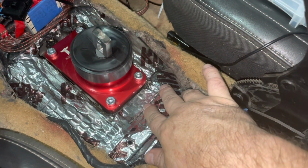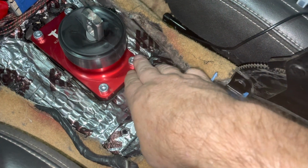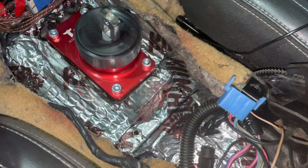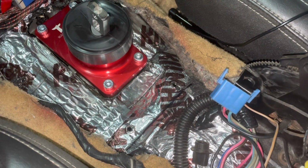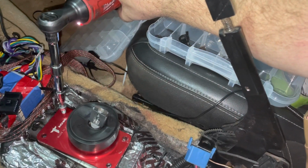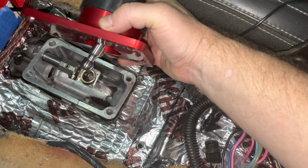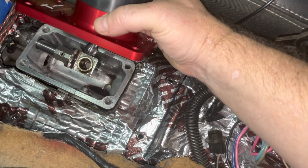All right guys, got the lower boot off, pretty much just some screws around here. And next we'll go ahead and get this tick shifter off. Now again, the cool thing about this tick shifter is there's no silicone to clean off. It's a gasket, so very nice. So I'll go ahead and get these 4 bolts off, and then we're ready to get this car up in the air and start the fun stuff. Bam, there you go. Now, that's the T56, so we're pretty much there.